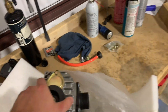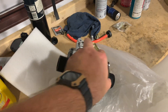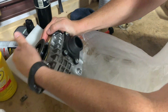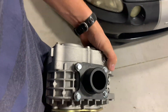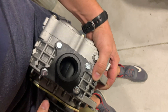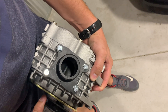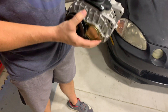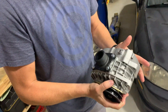It takes 90 milliliters of gear oil — supposed to have 85W90. We're just gonna put a little WD-40 in there, it'll be fine. As you spin it over you can kind of hear it make a little bit of noise. It'll actually make some suction. This is a two-rotor design — they intermesh with each other. What they do is take the gas: this is the inlet, and the gas actually goes around the outside and then down the bottom. You can spin it either way you want — if you spin it the other way, it pulls the gas from the bottom around the outside and up. However you need to mount it, it can go either way. It does have one fill and one drain, so depending on how you mount it you may not even have to take it off every time you check, empty, or fill the oil.